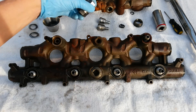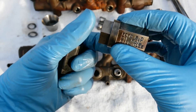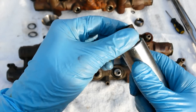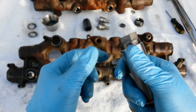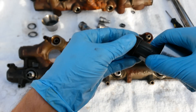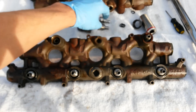As far as tools go, I would recommend a tool made by H&H Diesel — really a top-notch, high quality tool made out of hardened 4140 chromoly steel, a more robust and solid design all around. The best thing about it is that once it's engaged with the socket, you know it's not going anywhere. With the Boss Tech tool it can slide down in there and you're not sure if it's all the way engaged. If you're going to use the Boss Tech tool, definitely use a short well socket.